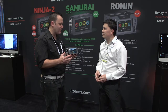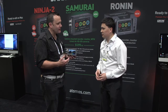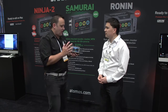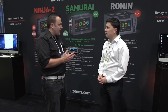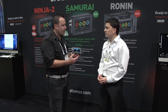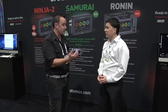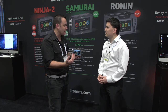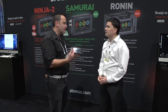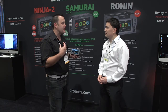The biggest thing is that we've updated the screen. This is a 1280 by 720, 5-inch screen — you can see it's a full 16 by 9 perfect aspect ratio. We worked with a panel partner to customize this panel. You get 48 Hz, 50 Hz, 60 Hz operations. Whatever the video format is, it changes to that frequency so that you see the perfect video. We can adjust gamma, contrast, and brightness — we've got full range of control over that. It's really an awesome IPS panel.